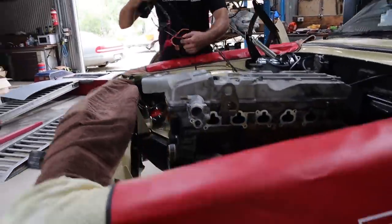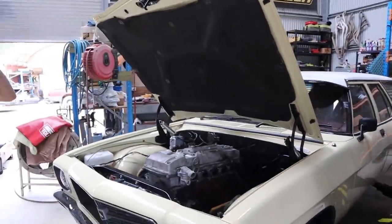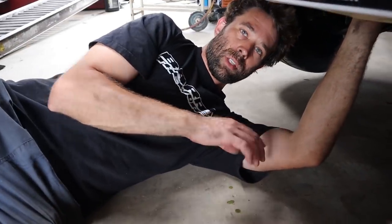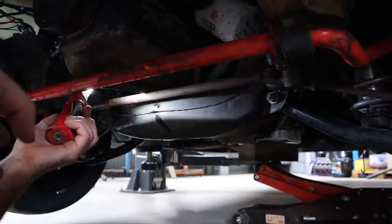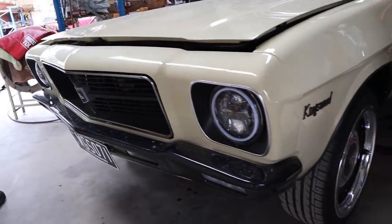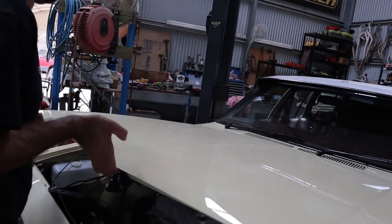See how much we can come up and hope we can do it basically. Bonnet's on. See if we've got any clearance. Oh no. That rib is right behind the VCT. So the bonnet won't shut, and we are literally on the drag link on the pickup on the sump, which is a problem. Obviously the drag link being a suspension component, you cannot modify it. It's not even close. There is a heat shield under there but even removing that it's not going to get us that much room.